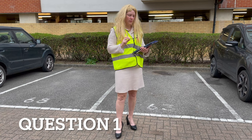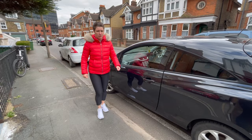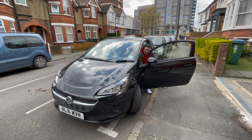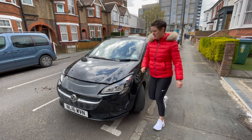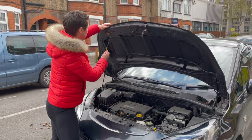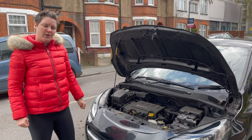Can you show me how you'd open the bonnet and tell me how you'd check the engine has sufficient oil? To open the bonnet on a Vauxhall Corsa, I come to the passenger side. There's a black lever here — pull it towards you. Once you pop the bonnet open, there will be a silver catch that you need to press to unlock it. We then have a stick at the front which you put into the yellow hole and that will hold the hood open.